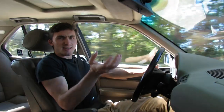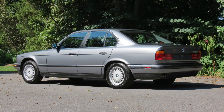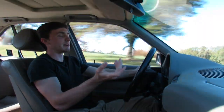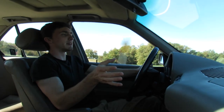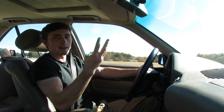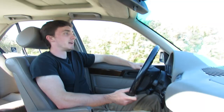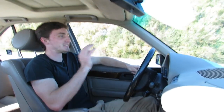There was nothing wrong with the stock ride — I just wanted to get rid of that monster truck suspension look. The ride height only dropped maybe an inch to an inch and a half in the front, and three quarters of an inch to an inch in the rear, so not much difference in height. I think the springs were already sagging a bit — this car has 230,000 miles on it. I'll show pictures of the other E34 I had, which seemed to sit a lot higher on stock springs; that might just be wear and tear. Your difference in ride height might be more significant. Overall I'm very happy with how it turned out — it's still a comfortable daily-drivable car and the ride height is perfectly on point.